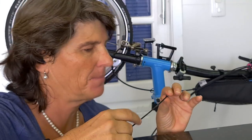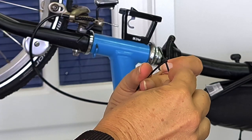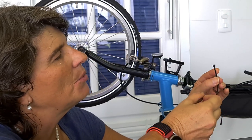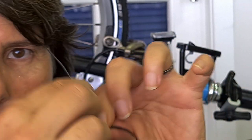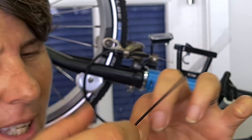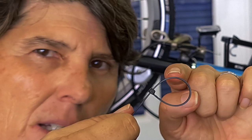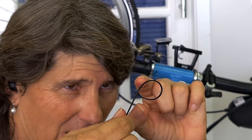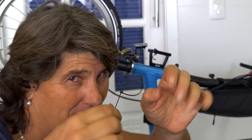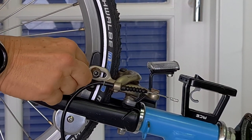One way of doing it is by using a ziplock. But don't put it in the right way, because if you do, you won't get it out. Put it in the wrong way — meaning you can put it in and take it out easily. It's not really working as a ziplock; the only thing it's doing is giving a little extra space for the rear brake instead of the front, so the front will touch first. Cut the ziplock and put it on the back of the brakes, inserted the wrong way.